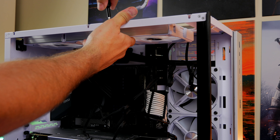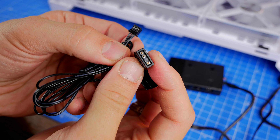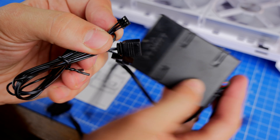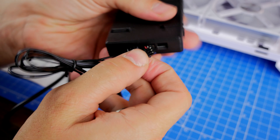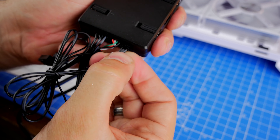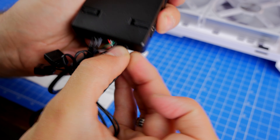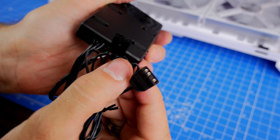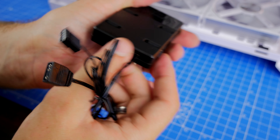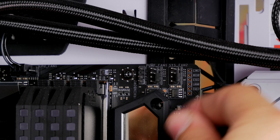There's another cable that plugs into the control box with a tiny little plug on it. The other end has two connections: one for the RGB header, which if plugged into the RGB header on your motherboard allows you to control the RGB lighting through your motherboard's software. In my case that's MSI Dragon Center. Make sure you pay attention to the instructions because sometimes you'll have different voltages. I'm plugging the power connection into the system fan header so it can be controlled, and then through the BIOS settings you can set your PWM control to control the fan speed.